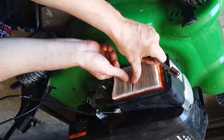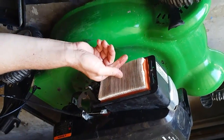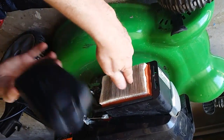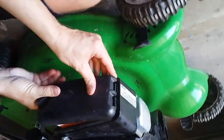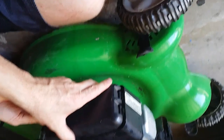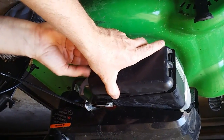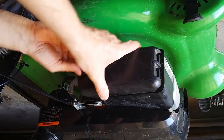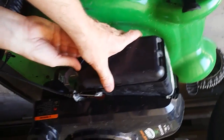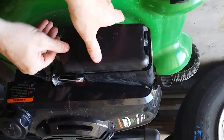So we're going to pause, get the air filter and get that in. Just put your air filter in — ours isn't that bad. The neighbor hardly ever used this mower, it's clean. And just snap these two latches in here on this side. You should be able to line up the screw hole over here — it has a built-in butterfly nut there. Once you get it lined up, it should just screw right on. So we're going to pause and show you how easy it is to start.